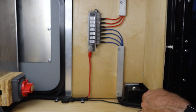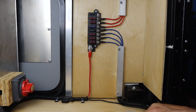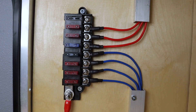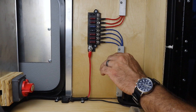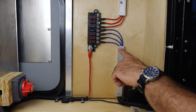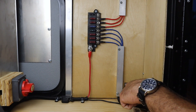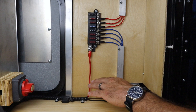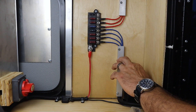Some people dislike this approach, but I've found it to be reliable as long as you have a secure connection and use a little grease to prevent corrosion at the ground contact points. Each distribution line on the fuse block has a corresponding fuse, so if there's any overload, the fuses will burn up before any surge reaches the lights or other components. I also used aluminum conduit and flexible line to protect cables wherever something could rub the insulation off — it gives a clean look and protects the lines.